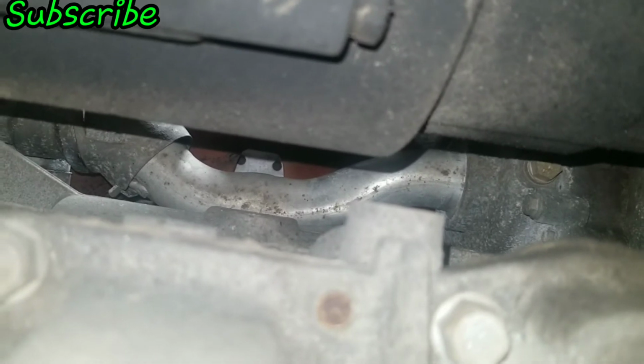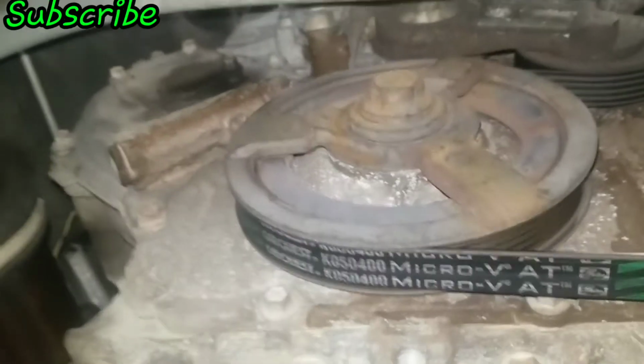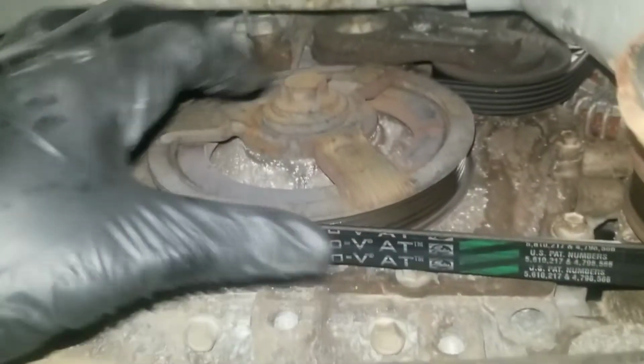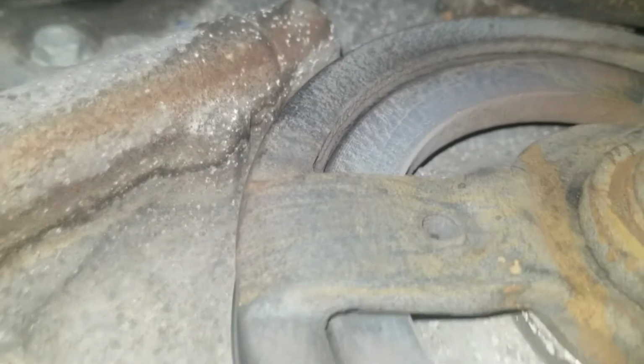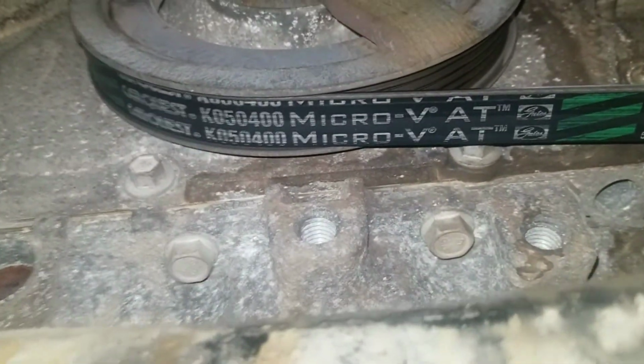So that's good. I'm noticing a wet spot right here. So I took this dust shield off that covered this entire area, so I could kind of see up where the water pump is. So I could kind of get to the water pump. And I have a feeling the water pump is going bad, but I'm not seeing any new leaks.